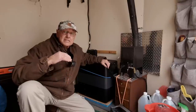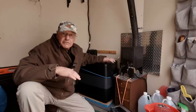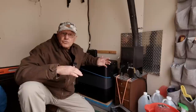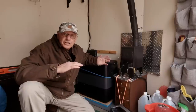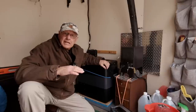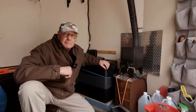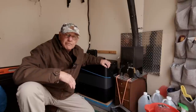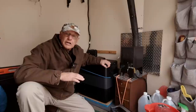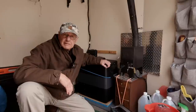Now what that means is on high, depending on the brand of refrigerator, it'll shut off at around 12 to 12.2 volts, so it protects your car battery. If you have it set on medium, like on a deep cycle battery, I'm pulling this off the top of my head, I should be looking at the manual, but it's more like 11, 11.5 volts. And if you have it set on low, like for a lithium battery, it'll shut off at around 9.5 volts, something like that.